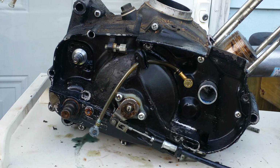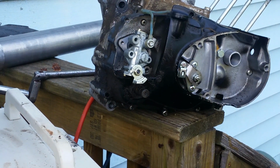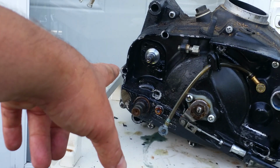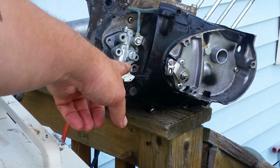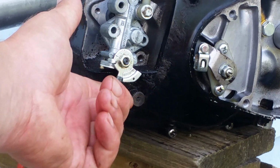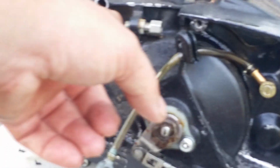okay, and now we're going to talk about oilers. The oilers are basically the same thing, but they are a little different. The one for the G4 right there basically mounts upside down. The one for the G5 has the throttle up top, the lever. So see this piece right here? You can see that now? Here we go, right there. That's the part that moves back and forth on your throttle cable. It grabs it from the bottom, and this one right here grabs it from up top.